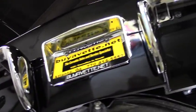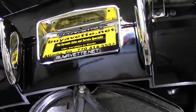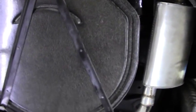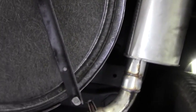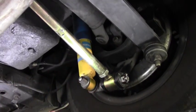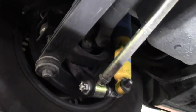As we take a look, our rear valance is in great shape as well as our bumpers. Whenever you're looking at a Corvette, it's always good to look underneath the bumpers because that's where the corrosion starts. These are in excellent shape. As we make our way under, our mufflers are new on the car. We can start to see our frame is in great shape. Trailing arms are as well, with the added strut rods for nice drivability — and that goes back to the AC and power steering making it a very drivable and fun car to own.